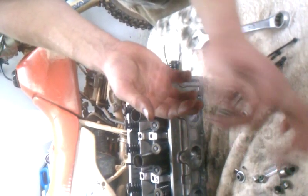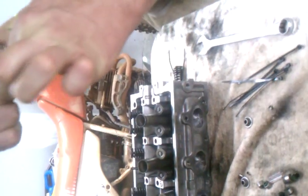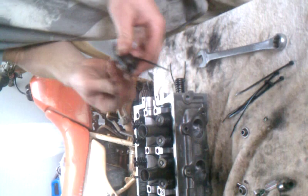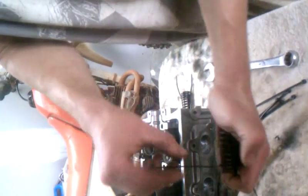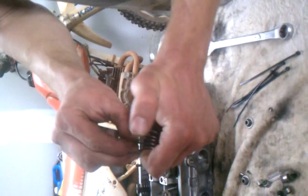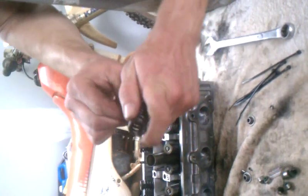Tie it into place — grabbing it like this, put your thumb on the head of the zip tie, squeeze on the spring, push on the zip tie head, and pull on your extra slack. Another trick: slide the zip tie first where the spring is coiled tighter. See, there are tighter coils here — more spring here than there is right here. That helps the head of the zip tie stay where it needs to, so it tightens down easier.